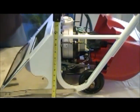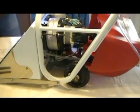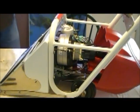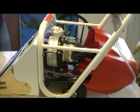And once the water is in the recovery tank, that's when the float switch, the blue switch down here, activates when the water level is about 3 inches in the recovery tank. The float switch activates this discharge pump. So with the efficiency of the vacuum system in this machine, the vacuum motor is only responsible to get that water into the recovery tank. The discharge pump is what gets the water away from the machine and into the toilet.